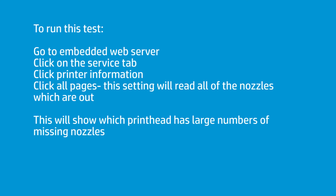This is a simple chart that helps you narrow it down. On the embedded web server, in the very last tab — the service tab — there's a way to go to all pages for the printer. You want printer information, and the last tab is all pages. Click that; it'll take a second. When it refreshes, it has gone up to the printer and read every single nozzle that's out, and it will list them: slot 1, slot 2, slot 3, slot 4, and so on. Since I already know it's a magenta printhead, I look at the nozzle-out data. One of them has a long string of missing nozzles, the other doesn't. That's the slot I pull.